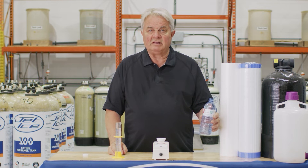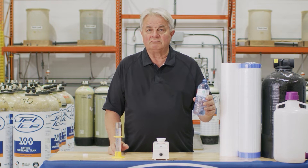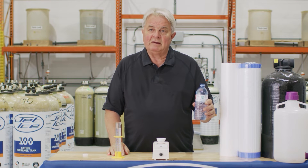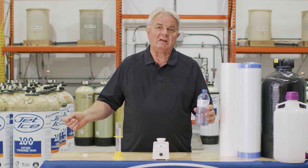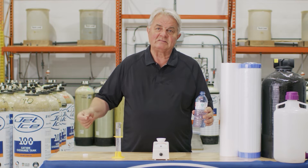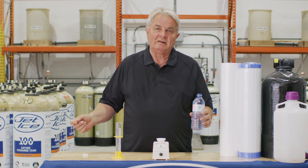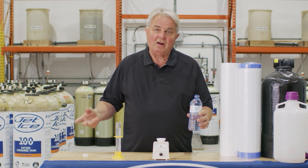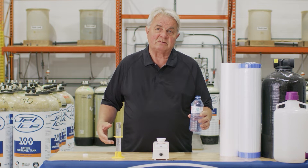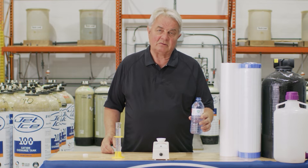Municipal water, city water — depending on where you live, every water source is different. This drinking water is sold just about everywhere by different manufacturers, but it has a TDS — a total dissolved solid — based on where they draw the water from. In some cases it's a well, in some cases a lake, but it's all treated: chlorinated or ozonated to kill bacteria. But it does contain minerals — magnesium, calcium, iron — all minerals you need in your system, but they affect the quality of ice during the ice making process.